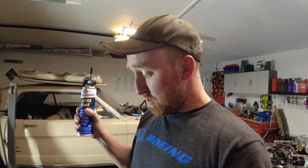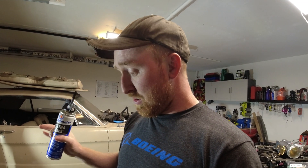The question I kept asking myself is how am I going to mount the fuel tank in the back? The vehicle itself is steel and the gas tank is aluminum, and aluminum plus steel don't really mix well together — they create corrosion a lot faster. My buddy Tyrell suggested just putting gasket sealer on there, which is what I'm going to do. I got a big can of gasket sealer and I'm going to put a bead all the way around the lip where it sits on the steel, so the tank actually sits on this gasket sealer. This stuff takes 24 hours to fully cure, so I'm going to put it on, smooth it out, and let it sit.